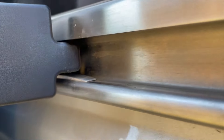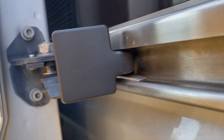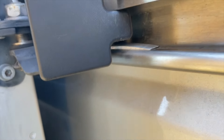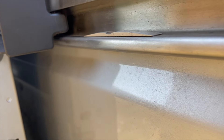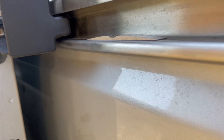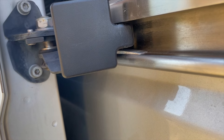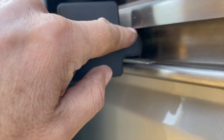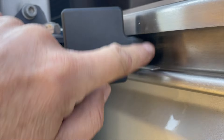It's at this point you can see why it's got to be quite thin — if it's too thick it will lift your roller system up too far and it'll jam under the top part of the rail. It's got it — a bit hard to film because the door's in the way. If I push it away from me it climbs back off the ramp. On my van you can see the gap above the black element to the stainless; if that was closed up it would jam as well.